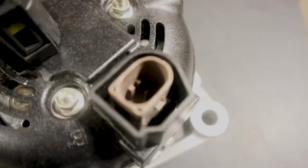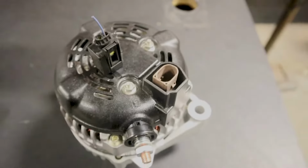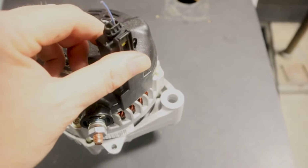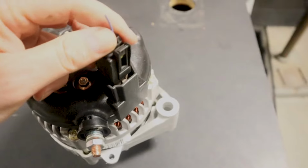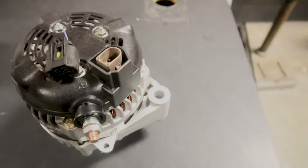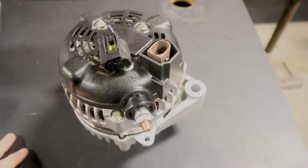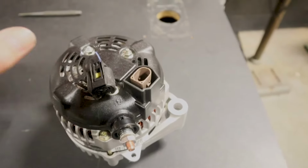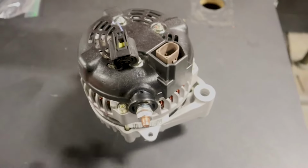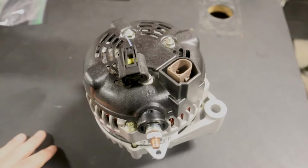You'll see these alignment pins in there. The alternator that I had the first time didn't have quite the right alignment pin in. And so this plug wouldn't go all the way in. It felt like it was going in, but it didn't. So I had a brand new alternator that wasn't charging. It wasn't the alternator's fault. It was just that the parts person gave me the wrong alternator. I don't know if it was misboxed or what, but it drove me crazy for a few hours